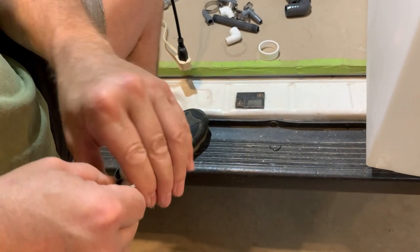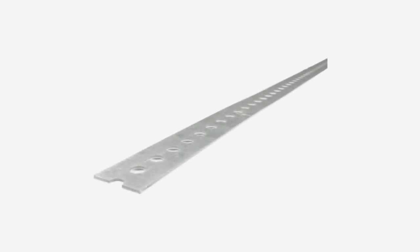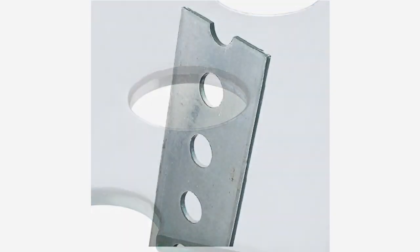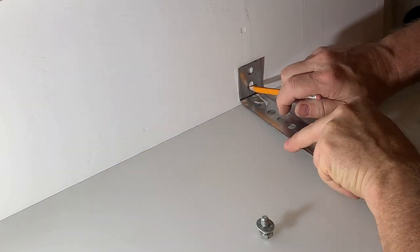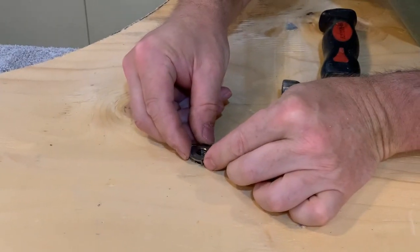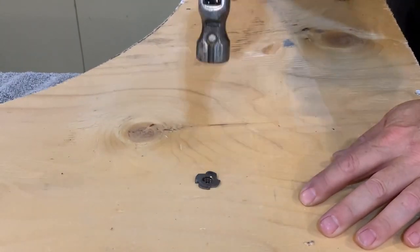Moving on to plumbing. When I purchased the water tank, I also purchased the fittings package. Here I am applying plumber's tape to the plastic fittings. To secure the tank, I have chosen to use 1-3/8 inch steel slotted flat galvanized metal — strong and easily bent to meet our needs. With the first of three bends complete, I can now mark the anchor holes on the plywood wall. I then removed the wall and installed 5/16ths T-nuts on the back side of the plywood. This will ensure that the tank can be removed at any time for service.